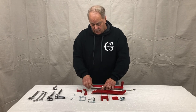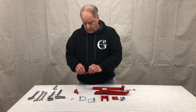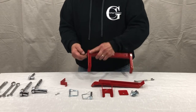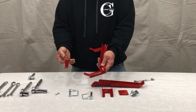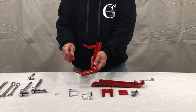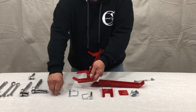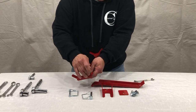On the second hook we're going to be using our rear retainer bracket. Do the same thing — put the screw through the face of the hook and mount the hook with the tab underneath. Here we take the retainer bracket, which has an oblong hole on the edge we're going to use. It'll tuck up underneath the bottom part of our support arm, then add a quarter-inch washer, black washer, and a quarter-inch nut.